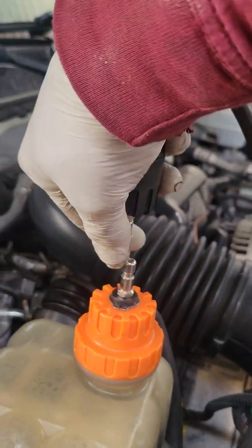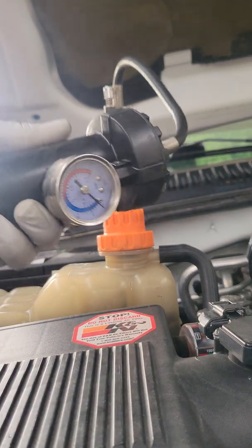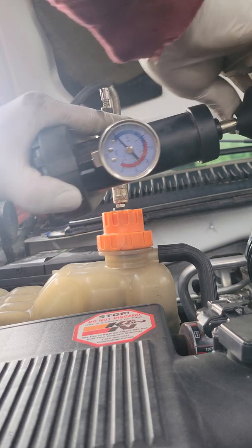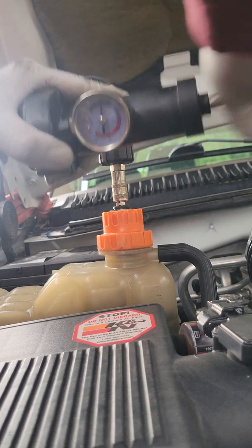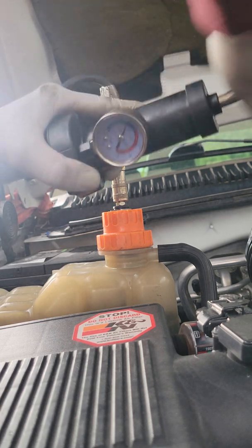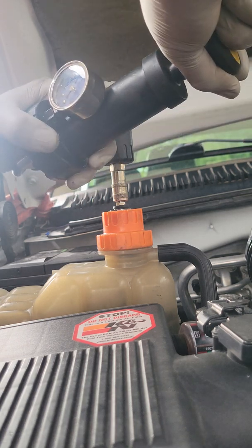Tool's on — snap it on you guys. We go ahead and get this pumping. You can see it's building pressure right now, it is at about six pounds. I'm gonna pump it all the way to about 15 pounds, which is the operating pressure of the cooling system, and that is because the cap is designed to only handle up to 15-16 psi of pressure.